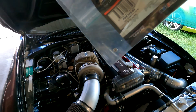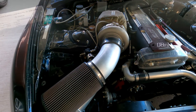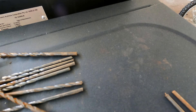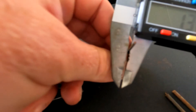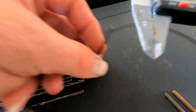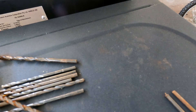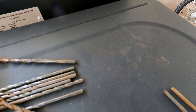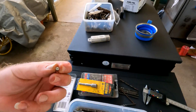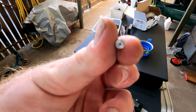Well, I'll put this on. It's going to have a hell of a lot of oil pressure since it's cold, but we'll get to that when we get to that. Let's see what it does. I've got a... 1.38. Make sure that's zeroed out. 1.47 — we'll just call that 1.5. And what's this one? We've got a 2.2. So I reckon we throw a 1.5 — put a 1.5mm drill bit through this sucker and put in a 2.2mm hole.